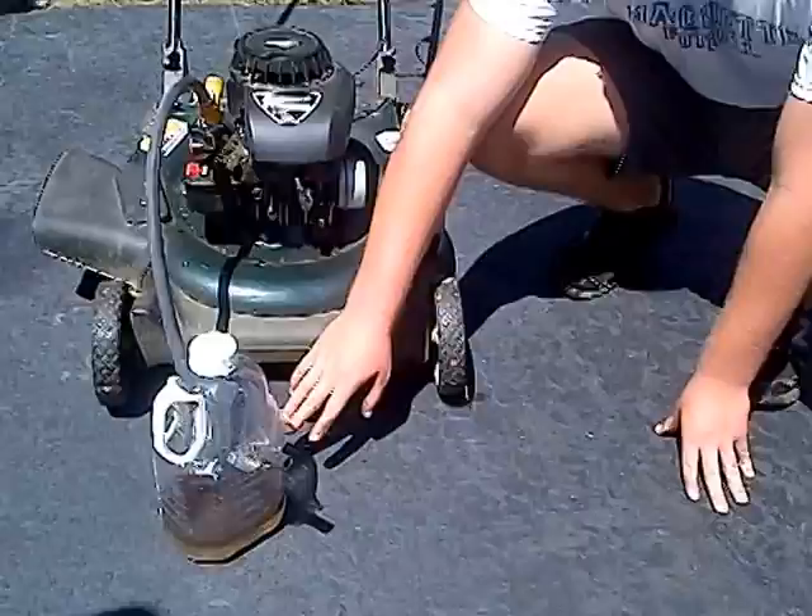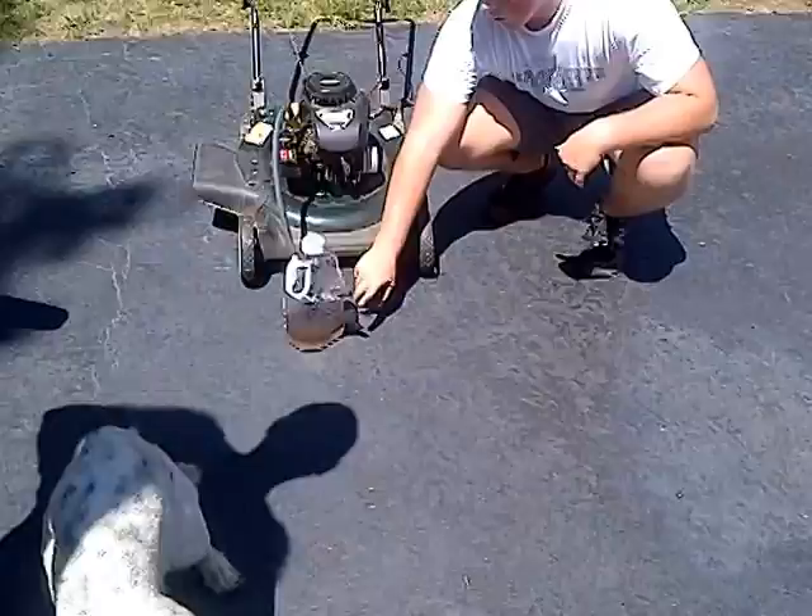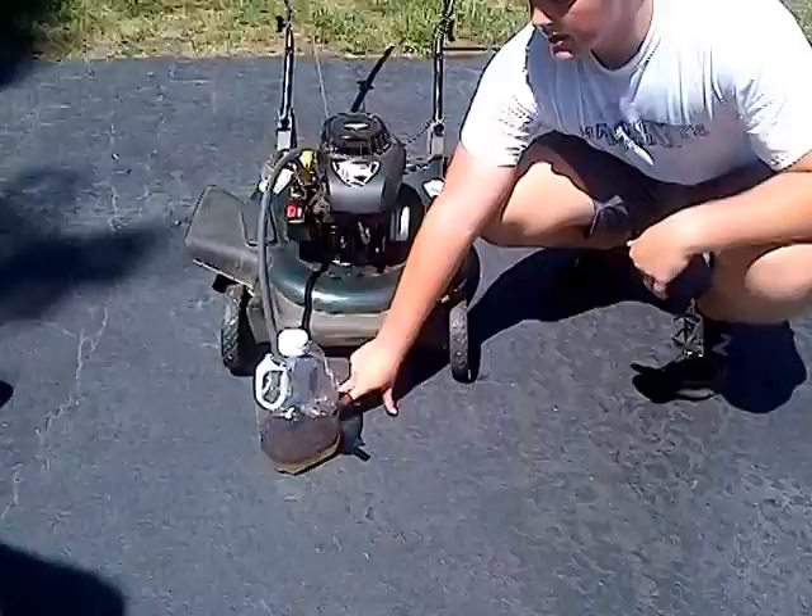So the theory here is... And what's in the bottle now? So in the bottle right now we have gasoline and water, which are two different densities. What happens is this intake hose is going to take air and take it all the way down underneath the gasoline and the water. It's going to bubble up through the water, through the gasoline, and create a vapor mixture within this bottle.